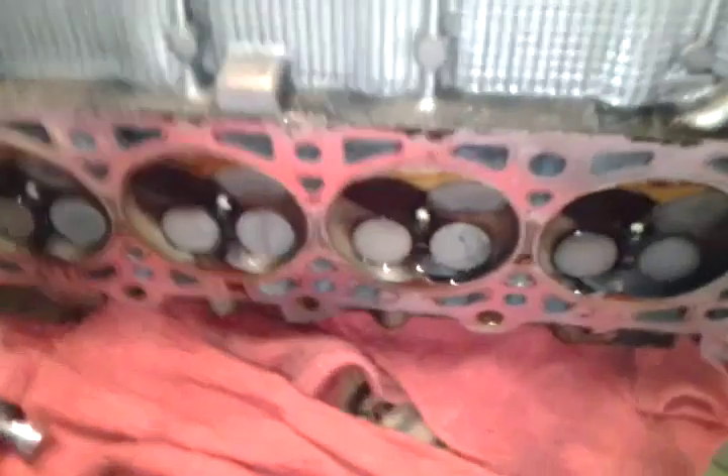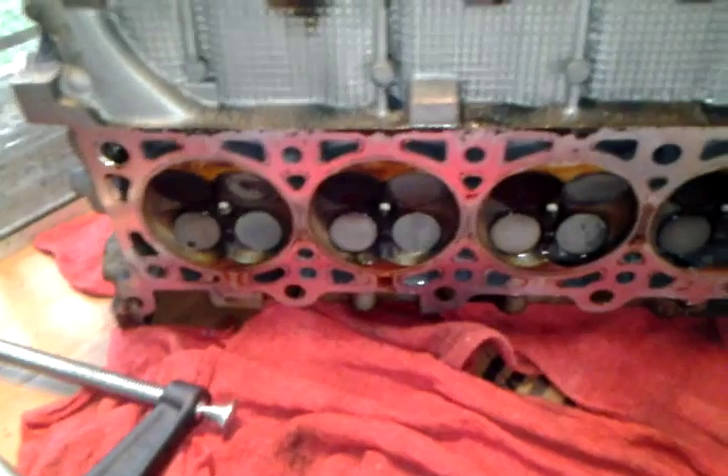You've got water dripping right here too. I kind of poured some out and around and whatnot. I'll even take a paper towel and just wipe this up — I can see it coming out of the metal. Definitely a leak. So it looks like we're going to be taking the valves out and re-lapping them.